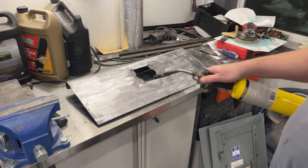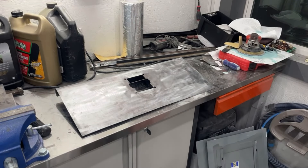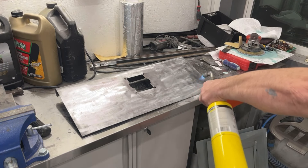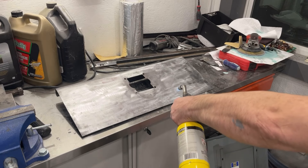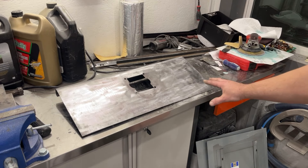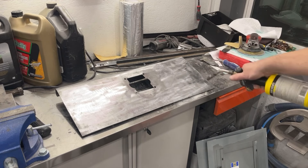Will I get it perfect? Probably not. It's seeming like it's wanting to stop now. I got this down a lot on this side, let's see if we can bring this side up a little bit. It's starting to come up. What I'm doing is working my heat from here towards there — I heat up this panel just a little bit all the way around, and now I'm going from here outwards to see if we can't lift that up. Don't want to go too far to the edge again.